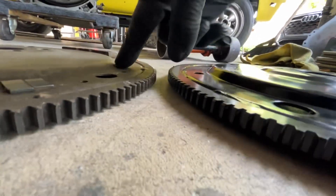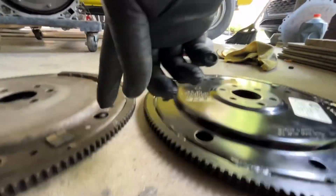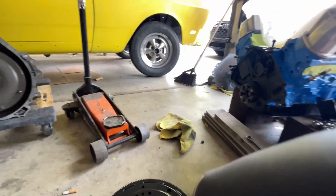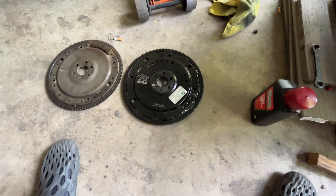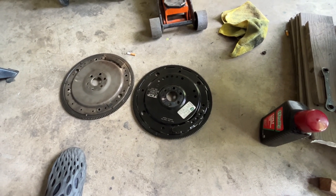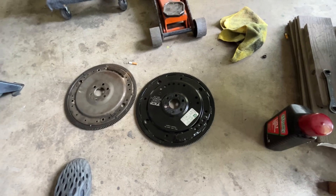There are two plates — this one has a low hump and this one has a higher hump, giving an offset of 1.92 millimeters once bolted to the engine. I attempted to put washers here and that gave me nine sixty-fourths clearance, or a little more than an eighth inch of pullout.